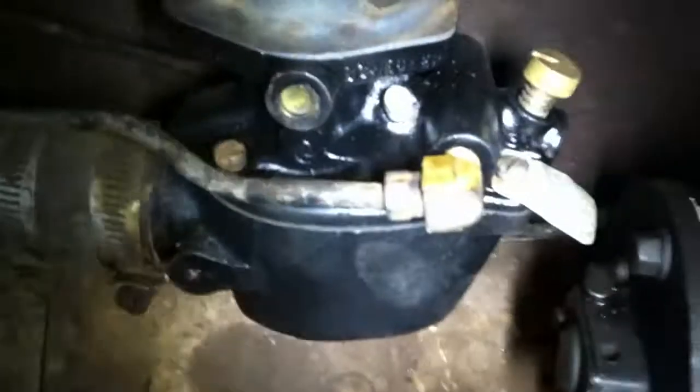Hi, Mr. Deeds. Yeah, I think I figured it out. I adjusted that main jet right here and did a quarter of a turn, and it runs great now. But it won't start without the choke, which is a little weird.